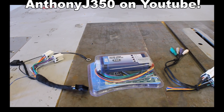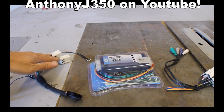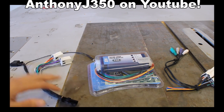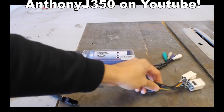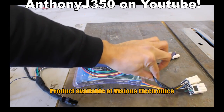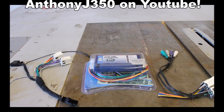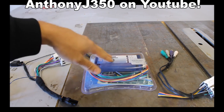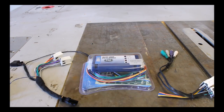On the bench we have three examples of how you would wire up a Nissan — there are several ways to do it. Over here's the first way: because we're dealing with enthusiasts, we just use a regular Nissan adapter and power it up through the head unit — very simple. Now, if you have the Bose system, there are two ways. You can use this cheaper harness over here; however, if you have a head unit with very low voltage pre-outs, you might induce noise because this doesn't filter it. What we prefer is to speaker-level it in — sending a high-level signal — and then this PAC piece will lower the signal level so the Bose system can re-amplify it.